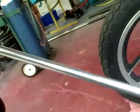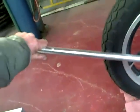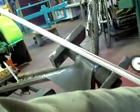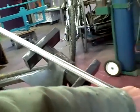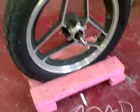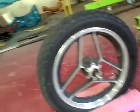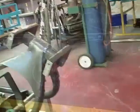And then we take our imaginary line here and mark from the front end up there to the triple tree. It's easier when you don't have the camera in your hand, then you can figure that out. At any rate, I marked it and measured it, and we're going to do a 38-inch front end overall. The rockers will be right here, and the front end will stop right there, and the usual. Anyways, 38 inches, because that's where pad point is, and that's what this dictates.